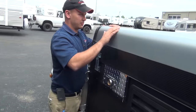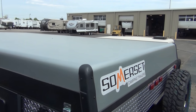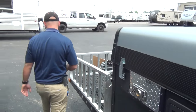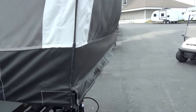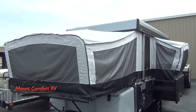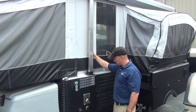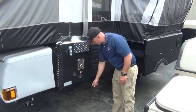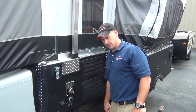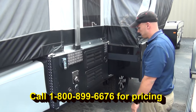Take a look at the top — one piece of formed aluminum. No fiberglass, no rubber, no nothing. One piece of formed aluminum that's capped on the edges. Two million dollar Prevost motorhomes use aluminum up top — that's what they're using. You might also ask why there is no flap over this. With no structural wood and all stainless materials, if I poured water here it would come out right down here on the bottom. These are bolted into the six-inch tubular steel. A lot of other setups are bolted in right underneath the cabinetry, so they have covers because if water got in it'd go right into your camper. Water gets in this, it goes right through — it doesn't hurt anything at all.